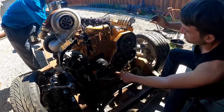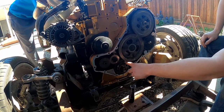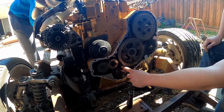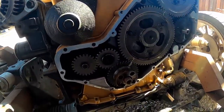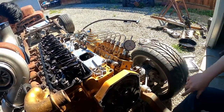You'll see the marks start to rotate counterclockwise. The next thing we're going to look for is — you're going to be watching the dial indicator, and it's going to be dropping as you rotate the crankshaft counterclockwise.